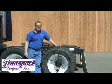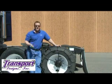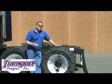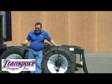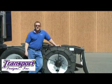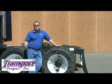Nothing confusing about it. It obviously gets a lot harder when it's snowing, wet, dark, and there's trucks up and down the road. Make sure when you're getting ready to chain up, you leave enough space between you and the vehicle in front of you so you can roll up onto your chains. I've seen guys make that mistake and basically get cornered, and you need that extra space.